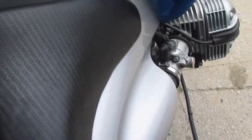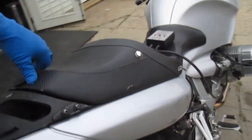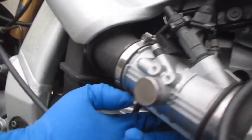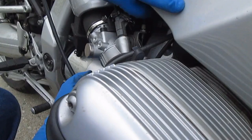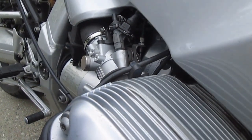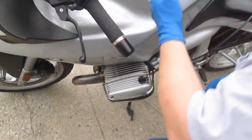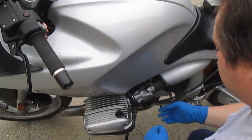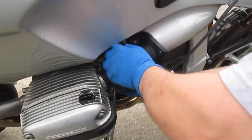First thing you need to check is free play at the cables right here. You have to make sure there's one millimeter of free play. What you do is take the bell crank on the bottom, hold it back, pull on the barrel — you see how the barrel moves. That is good. If it doesn't move, that means the throttle body butterfly is cracked open slightly, which means the pulses of the engine running beat the hell out of the throttle body shaft. Then you have an air leak at the throttle body and the bike will run poorly.